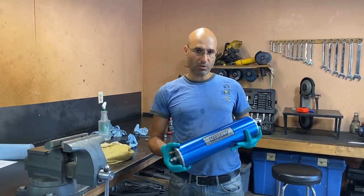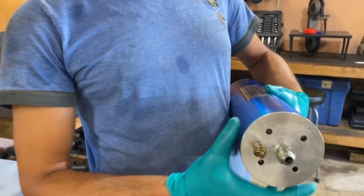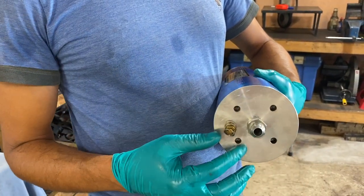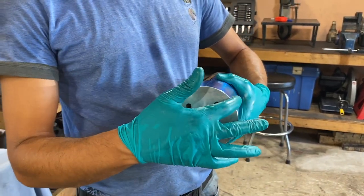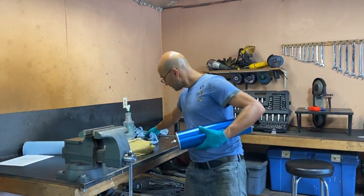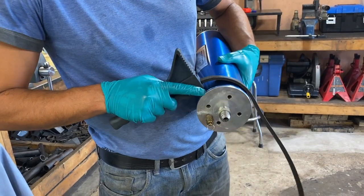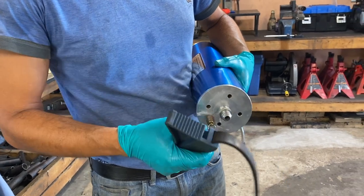The accumulator is all finished. I put the cap back on — put the piston in, stopped it in place — making sure to put oil on the o-rings before putting it in. On the outside o-ring I used synthetic grease, and I put some engine oil on the threads and threaded it in place, just using the rubber gripper to hold it. Then I would move it slightly to spin the cap while holding a wrench on the nipple.